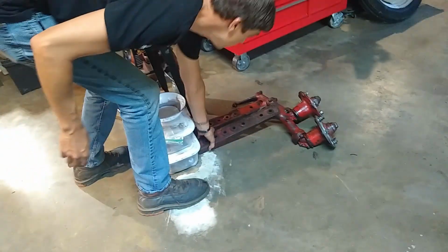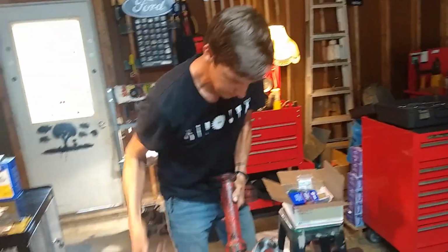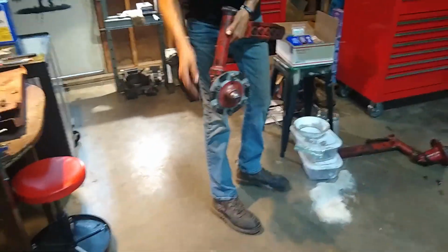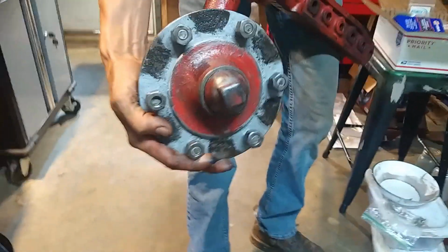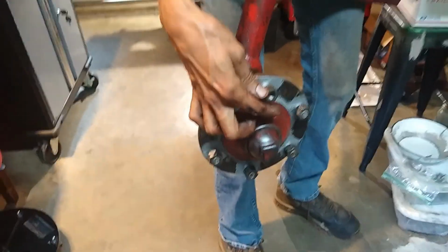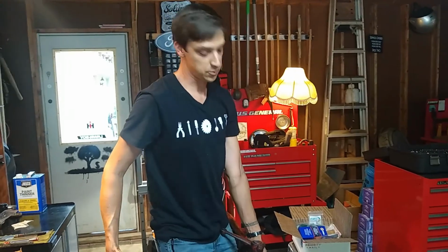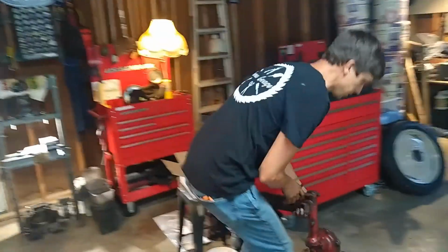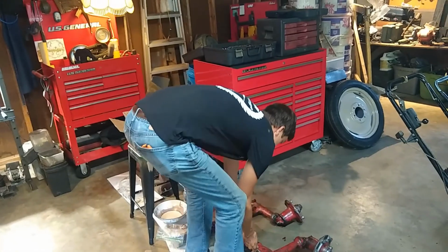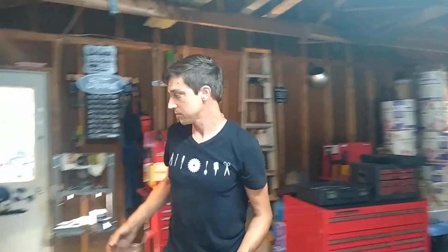So there were other parts that were replaced. Here's the last thing. I rebuilt the spindles and the bearings. Everything spins nice and smooth now. A lot of the time on the 8N really has been spent fixing destroyed threads. I mean, my hands were sore from running a tap and die some days, where I would be doing it for hours on end just because the bolts were so nasty. A combination of lack of care in assembly and also just age.